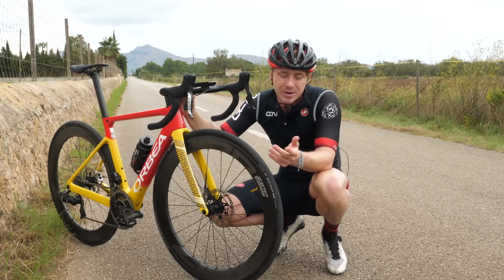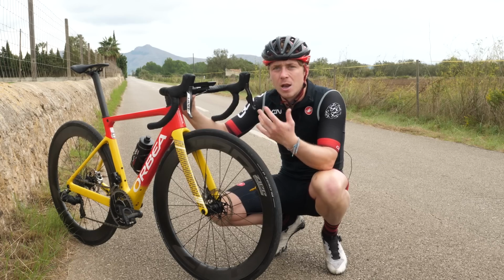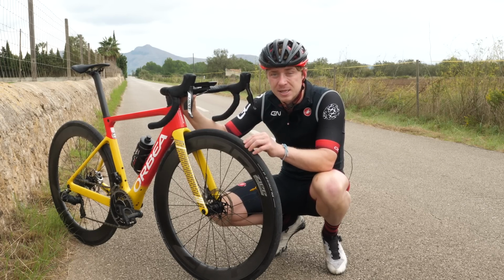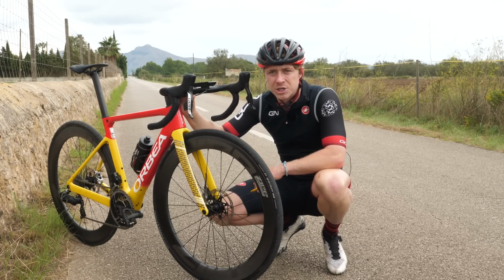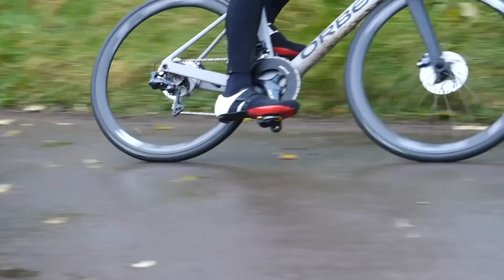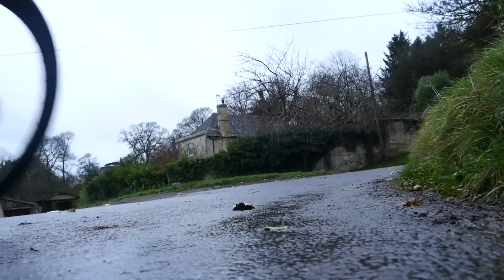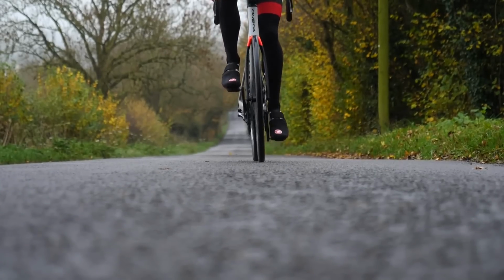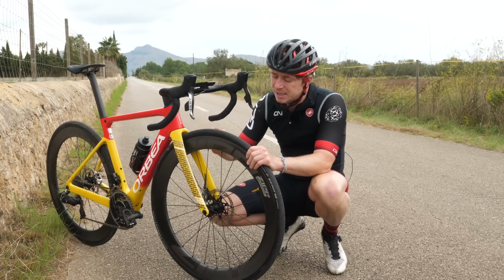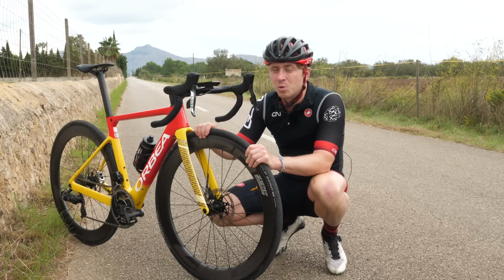The next thing to think about is the width of the tyre. Now I'm riding a 30 width. This means that I can run a bit lower pressure, and I'm also riding tubeless. That way I can run even lower pressure without worrying about pinch punctures. But when it's wet and the clouds open, the rain falls, debris comes into the road, meaning the chances of puncture become ever more growing. So finding a tyre that is also pretty resilient is going to be something to look for also.